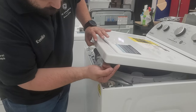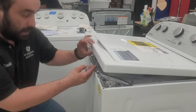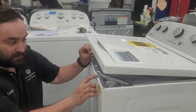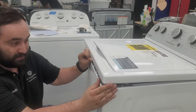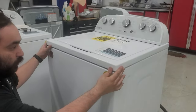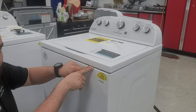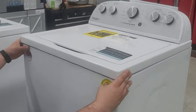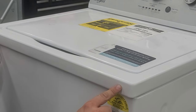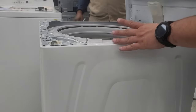No tool needs to enter the front of the machine. You have to make sure that the machine fits under this lip when it's time to reassemble. Place it softly, wiggle back and forth, and the lip of the machine will be sitting on top of this tang. Pull back till it falls and push back with two fingers.